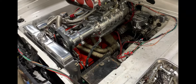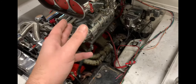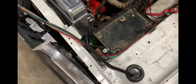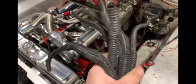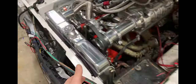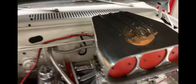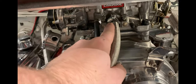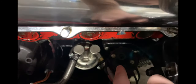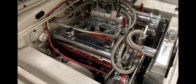I keep rambling. Wiring harness is unwrapped. I have to relocate several wires because of the way things changed when I moved to this setup and with the new ignition. Painless wiring harness — their loom wrap is fantastic, really easily reusable. You can seal it up at the ends with tape. I didn't before, and I'm glad I did not because we have to make changes in the way the harness is laid out. These are my heater lines to the actual heater box and then back through the carb heating plate. Mechanically we're there — just need to connect a couple little things and move the coil up away from the fuel pump, maybe on the inside of the fender well.